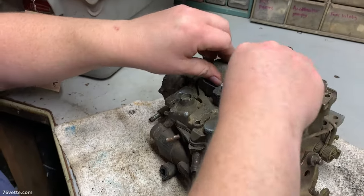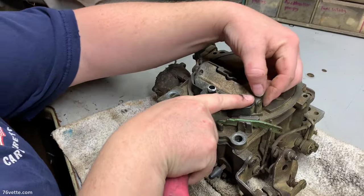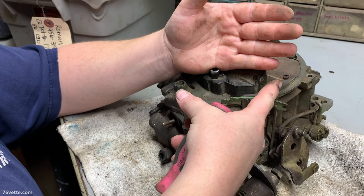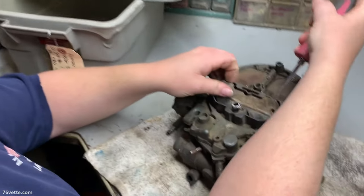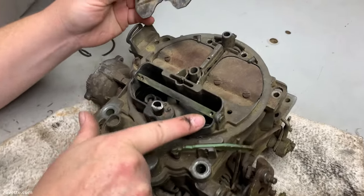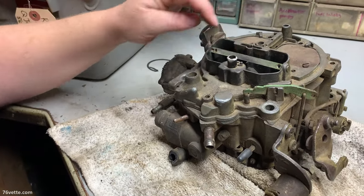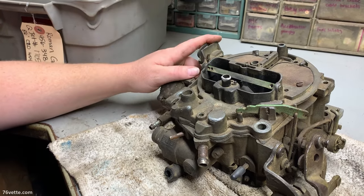It's pretty rough, isn't it? These are pinged on the back, but since it's flapping open because of how this is bent right here, we're going to have to heat this metal up and get a jig that we have, attach it to the carburetor, add a lot of heat, and actually try to push that metal back out to where it should be. Some shops would just grind down the plate to make it fit — that's one of the things we do differently. We're going to actually make the repair to the body of this carburetor. This tube we can repair as well. If there are pieces that we can't find a repair for, or the repair is not successful, we'll replace them.